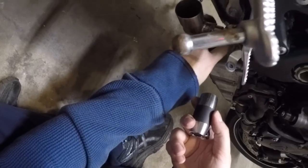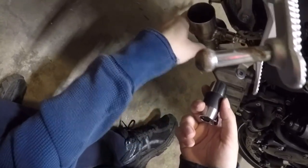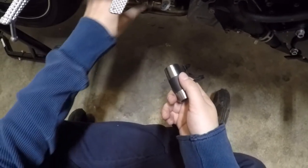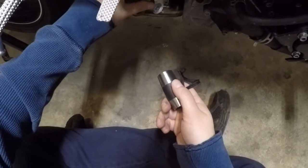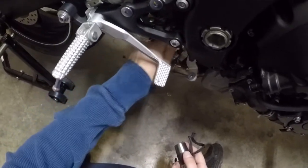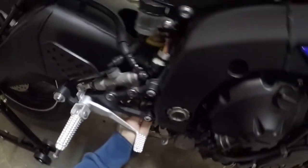After that, come around to the back. Right underneath the brake lever is the bolt where you hold on the back of the exhaust. If you're smart, you put this oxygen sensor screw back in before you even put the header bolts in, or it'll get all twisted — you don't want that in the way. That's already done.